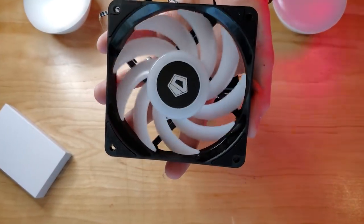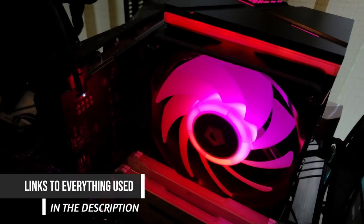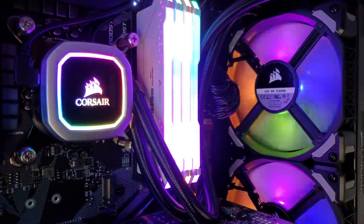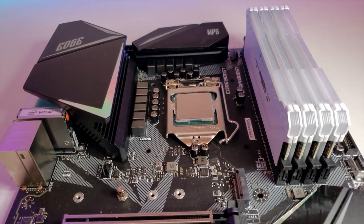To compare against, our mid-tier CPU cooler is the ID Cooling SE234 ARGB, which has a 200 watt max TDP and performed pretty well in my testing. In theory, we should be able to beat this cooler's performance pretty easily. And if we do, we might introduce a 240mm AIO to compare against. Our guinea pig processor is a six-core i5-9600K, which we're going to run stock to see if this even works, and maybe revisit overclocking down the line.